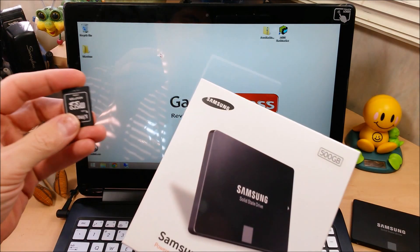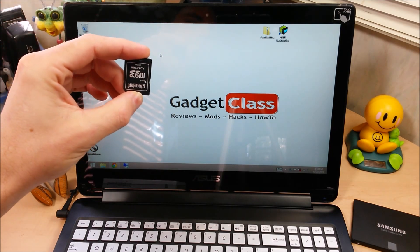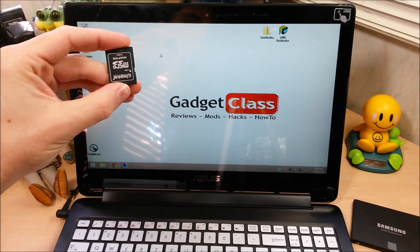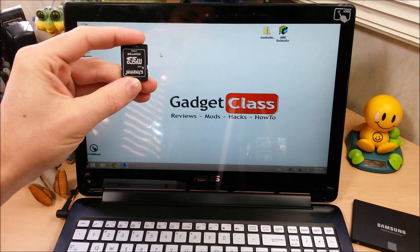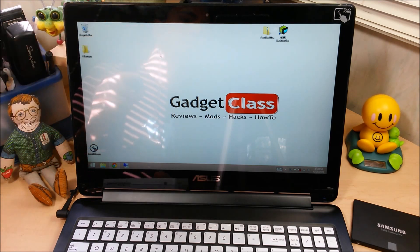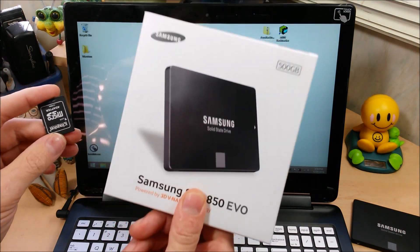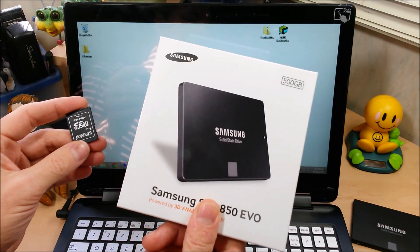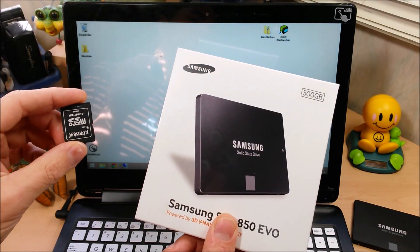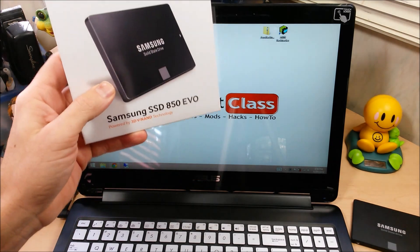What are the advantages of doing it either way? With the squeaky clean method, you get a completely clean factory restore image install — no spyware, no registry errors, no little programs running in the background. You're basically going to use your factory recovery media or a clean OS install disk and install a new OS onto your new solid state drive. That's going to make sure you have the best performance possible. I do recommend that way, but for those of you that want to keep your programs and settings intact, I'm going to show you how to do that in this video today.